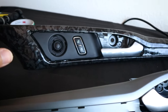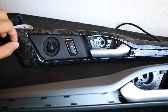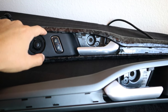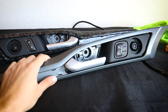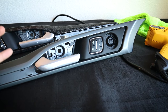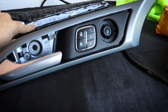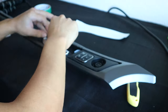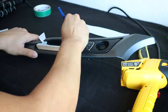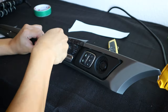I removed the speaker mesh from these pieces, which is going to clean up all of this area with the uneven cuts — it's very difficult to get nice smooth cuts around the jagged edges and little mounting points, but the speaker mesh is going to cover and clean it all up. These are actually my spare door trim pieces; the originals are still on the door panels which are getting reupholstered. An inlay is also useful for areas that are going to be harder for the vinyl to reach without being strained — if it's strained around hard angles it runs the risk of tearing, so inlays let you avoid over-exerting the vinyl while keeping the process more forgiving.